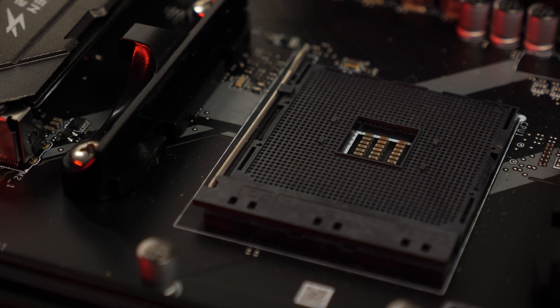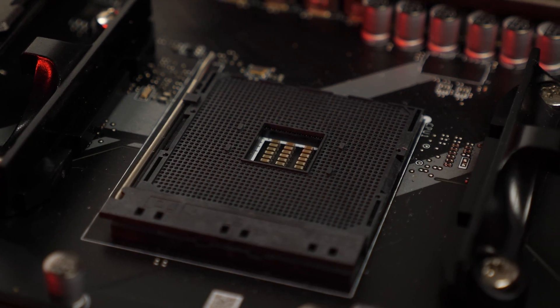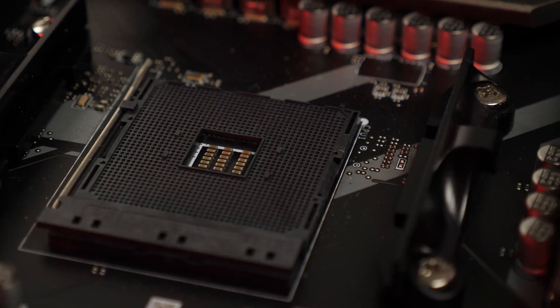The installation process will be extremely familiar to anyone who has installed nearly any AIO CPU cooling solution in the recent past. The largest difficulty arises from the fact that, for Intel users, AlphaTech does not pre-install any socket mounting hardware on the water block, nor do they even apply any thermal paste for you. Instead, you'll have to dig out the proper brackets and install them before you do anything else. In this, MSI and their Core Liquid Series is truly above average.